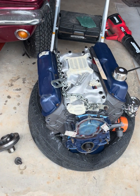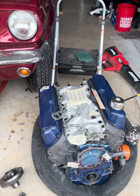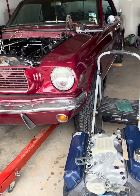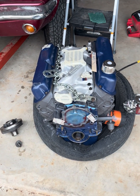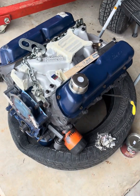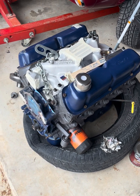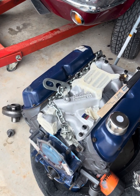This is a 1990s 5.0 that we converted to look like an old 289/302 to match this '66 Ford Mustang. We also swapped it to the original T5 that was on this fox body, which is all the way across the house. The only other thing we've done so far is switch to a cam with a 351 Windsor cam.